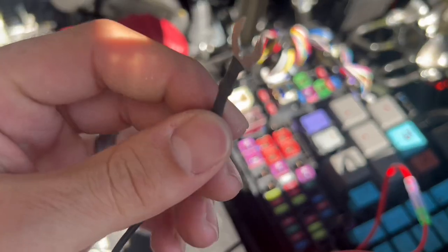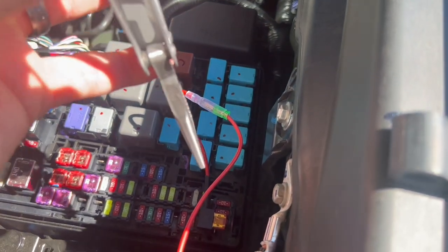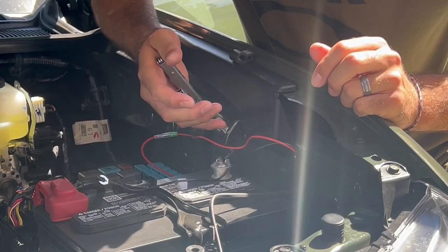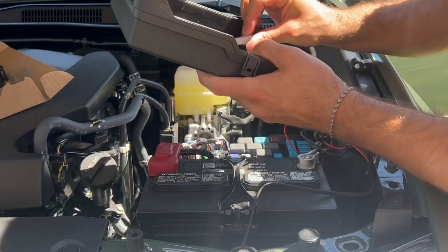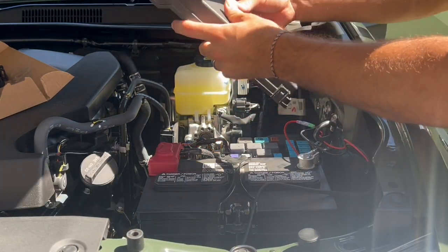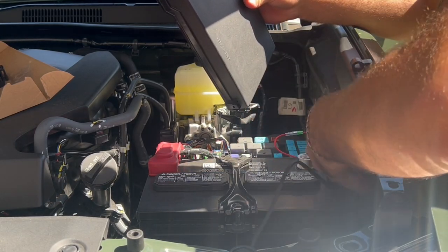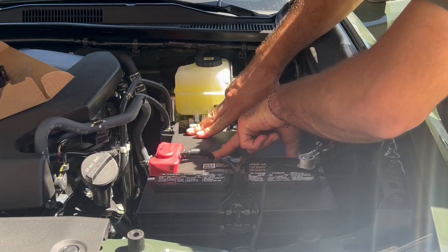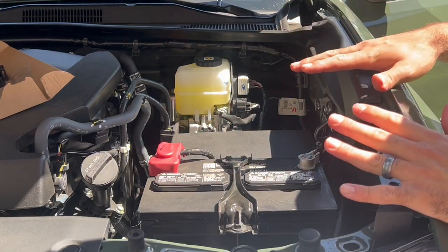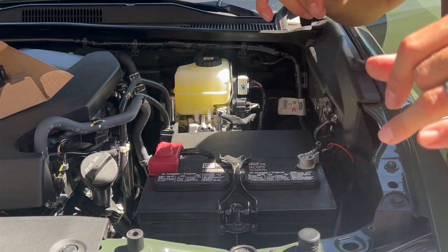Now let's go to the black wire — come right here, unscrew it with this tool, put the black one in and tighten it back up. After you're done, put everything away, save all your clamps and your extra fuses in case anything happens. Tuck the wire in and make sure you're not closing it next to a clip because it could pinch and cut it. And now we are all done — this is going to be connected to your lights, so when your lights turn on those will be on, and when your lights are off they will be off as well.